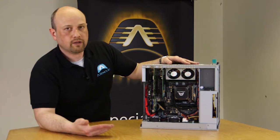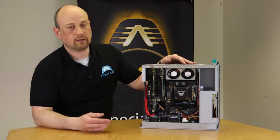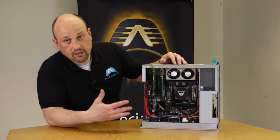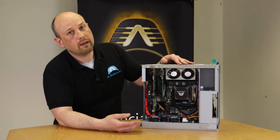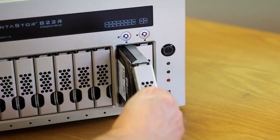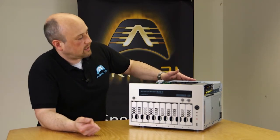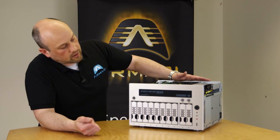Where you need lots of processor power for processing 2K video in real time — real-time colour correction and similar tasks — this system excels. It's been developed in partnership with Tweak Software and their RV application. This particular machine is loaded with 10 Western Digital 4TB RE drives for a total of 40TB, and can handle stereo 2K uncompressed video with real-time effects processing using the 8-core Xeon.